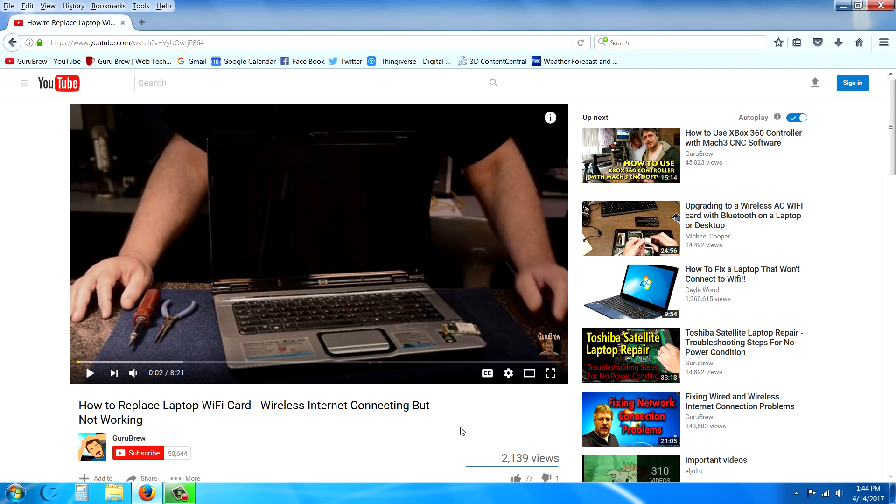If you've tried all these tips and you're still having problems, perhaps your wireless card is bad inside your laptop. That's not a big deal to change, but in my experience repairing computers, I find very few cases with actually bad cards — usually it's just settings or wrong passwords. However, if you want to replace your laptop Wi-Fi card, I made a video on how to do that. Getting a new card can provide new drivers and fix the problem. You can usually find cards on eBay for fifteen to twenty dollars. Thanks for watching — if this was helpful, give us a thumbs up and let us know your experiences in the comments.